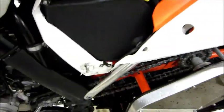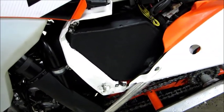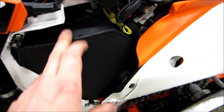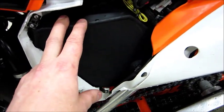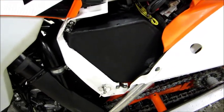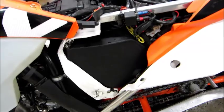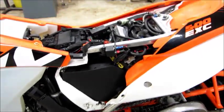You can hardly see much of the plenum here, but it's made very large, and we believe this is a good way to equalize the pressure pulses at the air intake of a single-cylinder engine. And it has proven to work well.